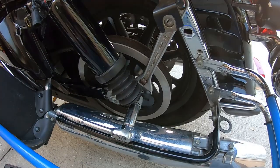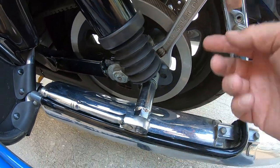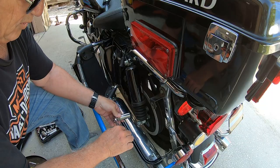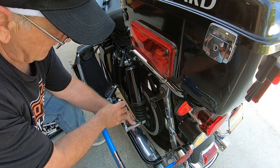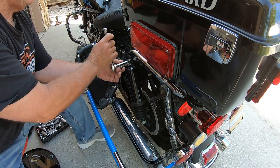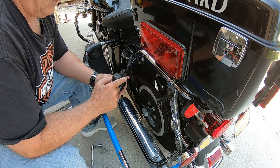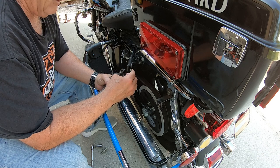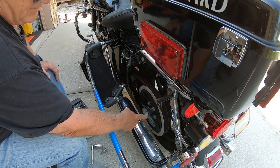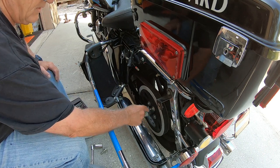I finally broke it loose. As luck would have it, I put an adjustable wrench here and as I was turning it, it got caught right there, which helped me because it stopped that inside bolt from turning. This bolt is a 13/16, this is a 7/16, and they were in there tight. Now I can see how they put this lowering thing on — there was another bolt here which I just took out, but this is the actual bolt where the shock absorber should go, so you have to take this out as well.